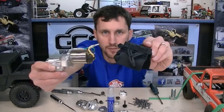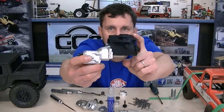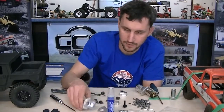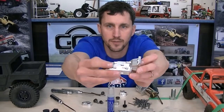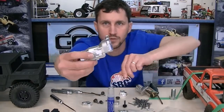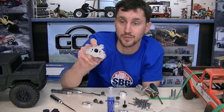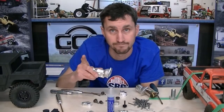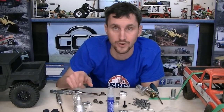And then you can put something like a scale motor right on top of all this. We left a couple of holes on the side of the transmission mount because you need some way to mount this up. There's already two holes on the top of the tranny from RC4WD — you can put an M3 screw in there. We left you some mounting holes on the sides for your own little brackets as well. It's narrow enough that it fits in an SCX with your own custom brackets, and you can also use it in pretty much any other custom build. Now that you can put a 540 motor on there, it's worth buying it. This is a cheap, good tranny full of steel gears. Use a low-turn motor though, because they're geared kind of high.